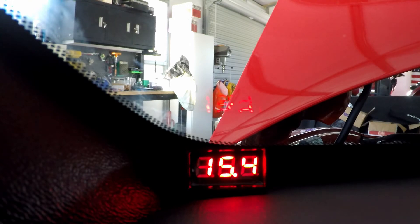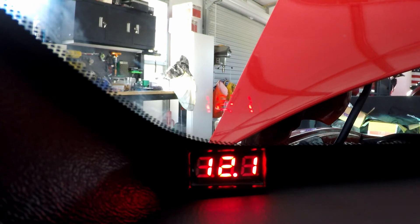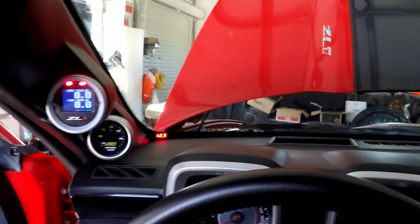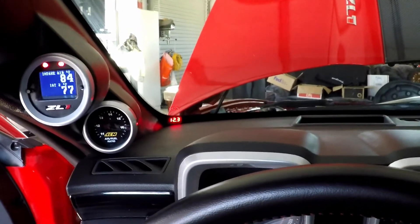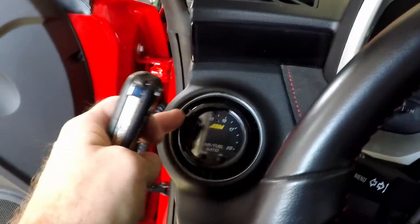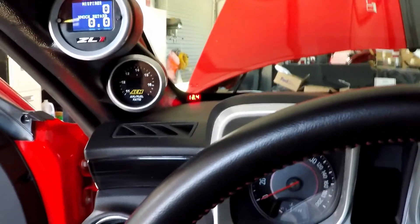Foot's off. About halfway down. And to the floor. So that works — that'll show me that I'm getting voltage and it's doing its proper function. I'm pretty sure if it failed, there'd be other telltale signs like probably no fuel pressure. Because if I don't have voltage to the fuel system control module, then I don't have fuel from my fuel pump. But it's just another knick-knack to look at. Way over there in the corner — barely see it. So let's see what kind of amperage this little thing draws, because that is going to be on all the time, even when the car is off.